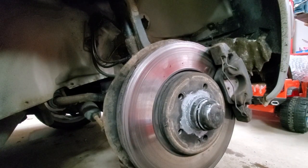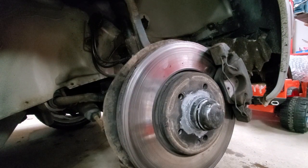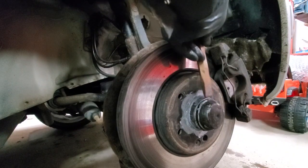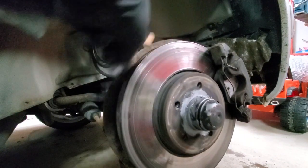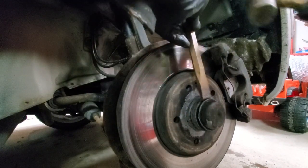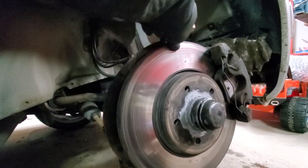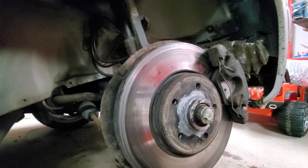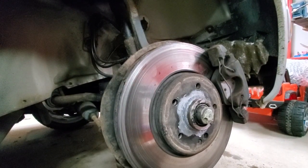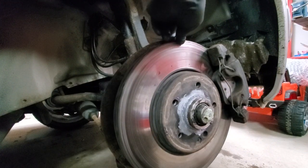As you can see it seems like the bearing is gone. This car has tapered roller bearings on the front axle. It was loose a bit roughly a month ago — I got it tight — and a few days ago I think the wheel bearing finally went.